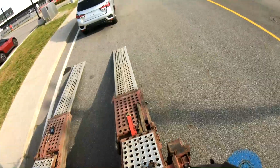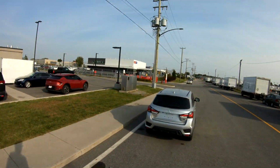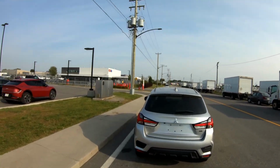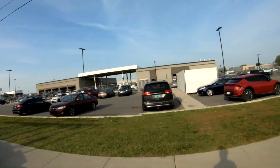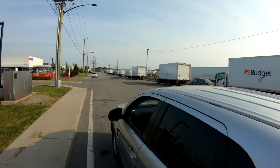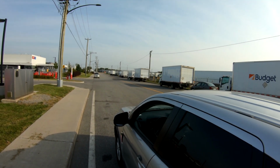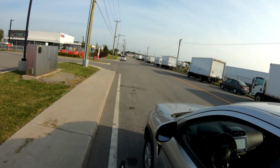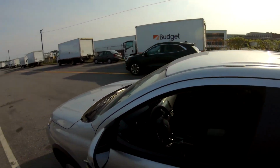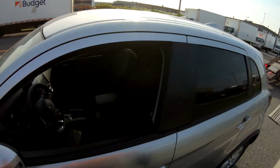Alright, that's that. Okay, now we'll do a walk around of the vehicle before I put it up. See, this one you always put on backwards because it's going up front. If it's a pickup truck with a tonneau cover on it, you always put it forward up there. If it doesn't have a tonneau cover, you put it backwards, and when you strap down the front of it, you strap it from the frame so that it pulls the truck down to give you less height, if that makes sense to you. So that's basically how it works.